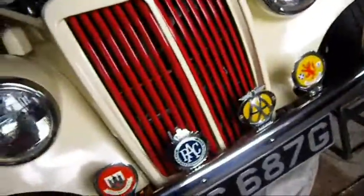But the main thing we've found is the thrust washers are totally mangled to nothing. One of them was lying in the bottom of the oil pan or sump. The other one, which you'll see under here, is still in but it's kind of wrapped itself round and all mangled up on the end of the crankshaft.